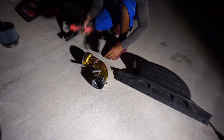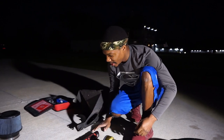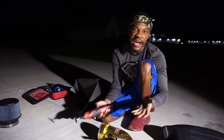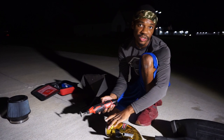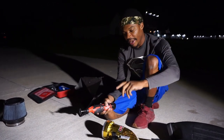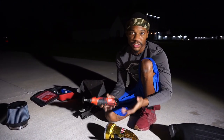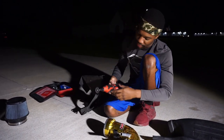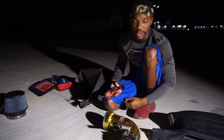If you're doing this with the engine short ram intake like I am — and a bunch of y'all bought this, and Dustin is pretty busy making orders for these things — I didn't want to wait on that. I'm just gonna cut this little flange off. I believe this is like five inches, so I'm cutting this flange off and cutting it down to the three and a half inch pipe. Once I do that, I'm gonna wrap some more of this gold tape around it to try to get it as close to four inches as possible, so I can run the four inch piping that I have.